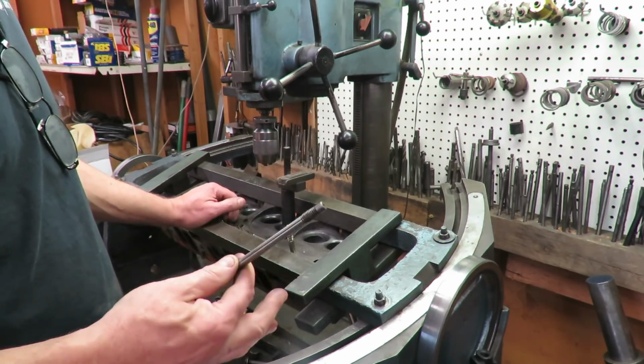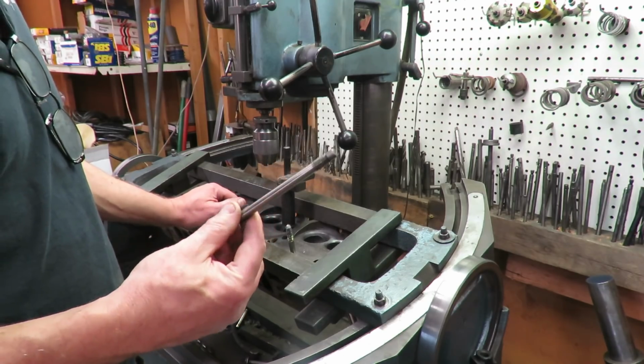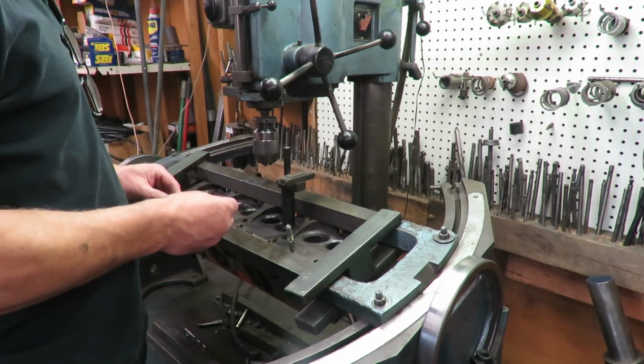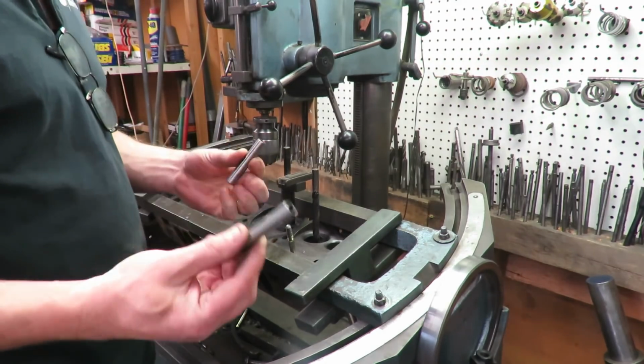But you got to let them know. And I'm letting you know now, if you get your guides knurled, that's a temporary fix, man. You're just patching the head, so it's not really the right way to do it. The right way to do it is to bore this out and use a driver.